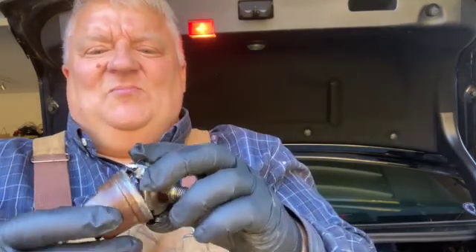This gizmo here — I took it apart. This is now number two that I took off, because the symptoms are: when the pressure sensor goes, it either has erratic pressure readings especially around idle, or it pegs once completely once you turn over the ignition. That is usually due to this thing being defective — either the original one or much like this one, the cheap made-in-China stuff.